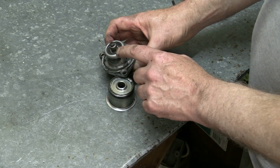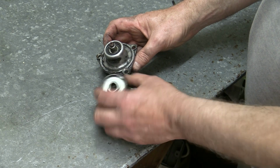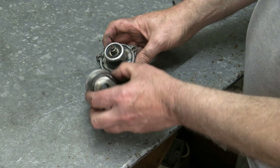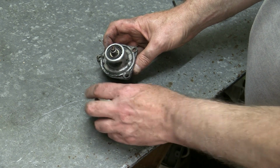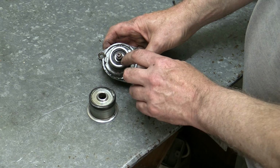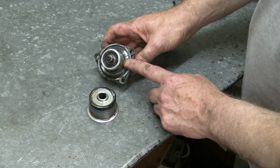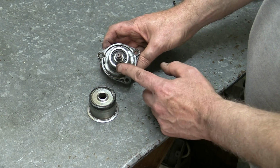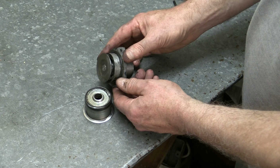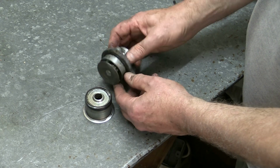I will change the bearings over and probably the water pump seal as a matter of course, because they've probably been fairly stressed, and this pump looked like it was running pretty hot when I had a look at it after I'd finished my ride. The end was all blue and pretty warm. So it'd be worthwhile changing the bearings. They're not expensive. The seal itself was relatively expensive, I think around $60 to $70 Australian when I bought the last one. But it's small insurance, and it's worthwhile getting it right this time. So the next video, hopefully, will show the rebuild of the pump.